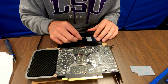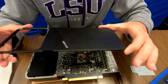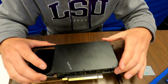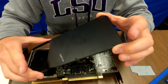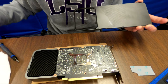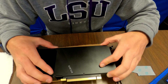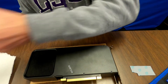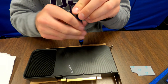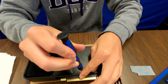Take our plastic off of the thermal pad and set this plate back on. Make sure your wires are plugged in — you don't want them unplugged. Slide the little feet in, then fold this down. You don't have to worry about it not lining up. Get your Torx T9 and get it started — don't tighten it all the way, start in the middle.